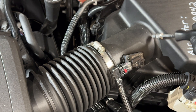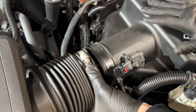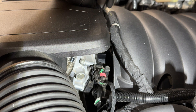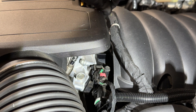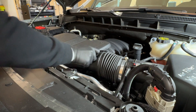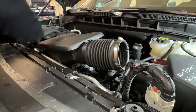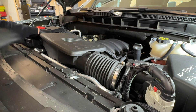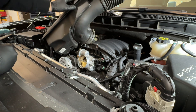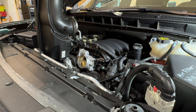Loosen the clamp just enough to get it off the air box and then gently pry it out of the air box. Then there's the other clamp on the air box — come down over the top and put your 7 millimeter on it and loosen it up. That should be good — now we should have everything disconnected and can pop this off the throttle body and pull it out of the engine bay. There's a zip tie holding things; just twist the tube up and leave it off to the side.